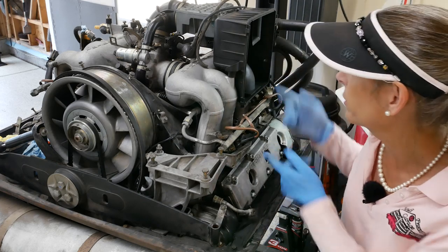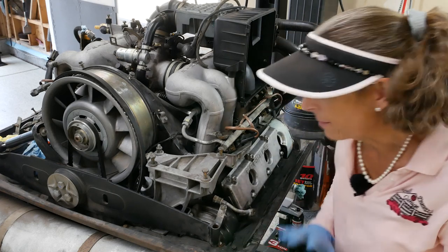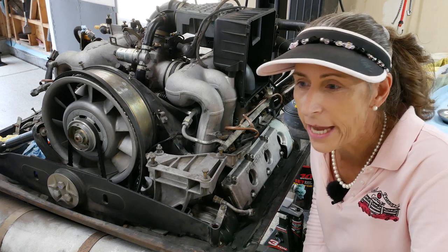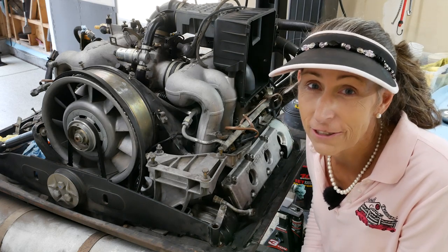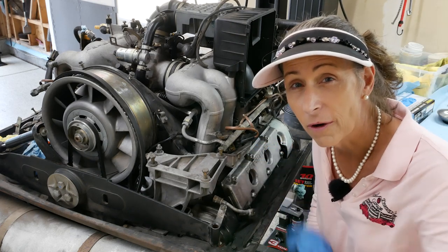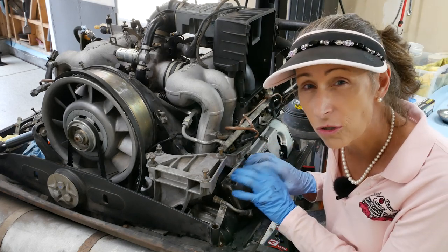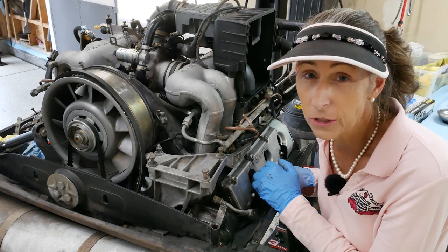That's the leak down test — it turned out really well. Two to four percent is hardly any deviation in any of the cylinders. We didn't hear anything crazy like air coming out of the intake or exhaust, so the valve train sounds in good order. We didn't hear anything coming out of the breather hoses either, so the rings sound good too. That tells me the heads are in good shape and the pistons are in good shape. That makes us think a bit about what we want to do to the top end — it's a lot of work to take the heads off, and I'll have to give that more thought.